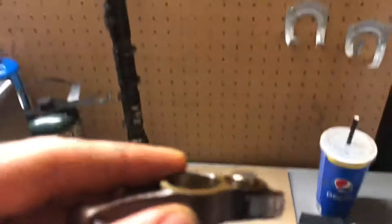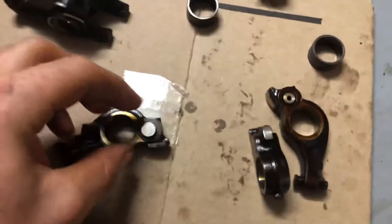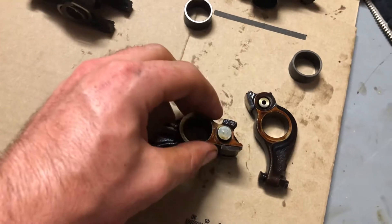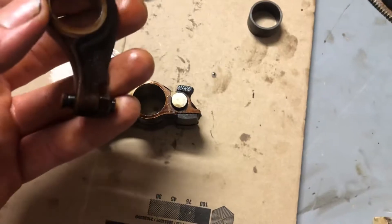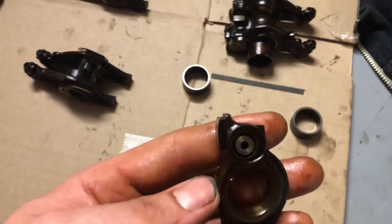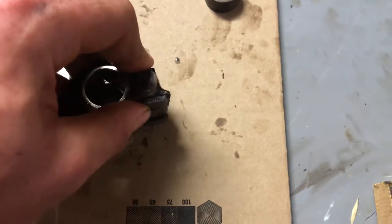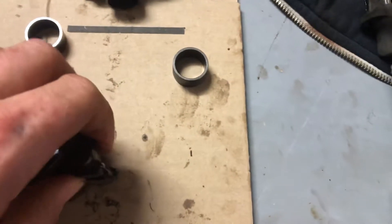Now it's down there all the way — as you can see it sticks up a little under halfway. When you go to sit the next rocker arm on it, it sticks up, and then when you put on the third rocker — sorry, this is the center lobe — it's got a spring in there. When you set that on, it compresses the spring and holds everything tight. It's actually the return spring from the way it works from factory.